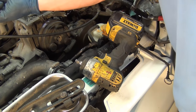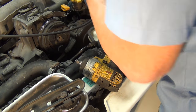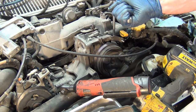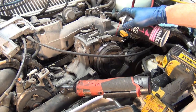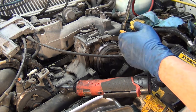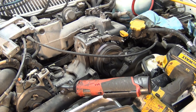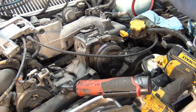Pull it out so it's on the wobble-hang part so I get the angle I need. That bolt snapped off the front of this — hopefully I don't have one snap off in the block. I think I got it. That was so hard and then it just gave up. Sometimes using an impact can be a good way to get these free — the shock can break the corrosion before the bolt gets a chance to shear. Just to be safe, I'm going to spray the remaining bolts. Be sure to check and compare the lengths on your bolts as they come out — not just on this car but whatever car you're working on. It can make the difference between breaking through an engine block or a timing cover and not, because if you put a long bolt where a short bolt goes, those threads will create all kinds of damage.